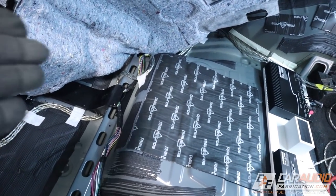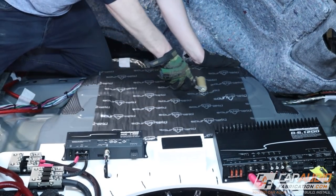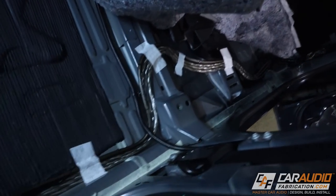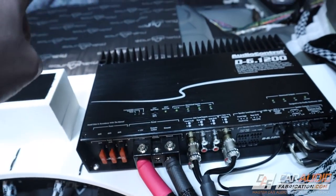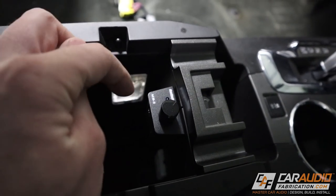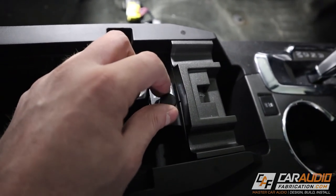Since I have the carpet removed and the seats removed, I figured why not throw down a little bit of sound treatment on the large flat areas that need it the most. So I did that really quick. Now I have completely ran all the speaker wires on the passenger side of the vehicle following the same techniques I used on the driver's side. On the passenger side, I've also ran my RCA wire here that connects to the head unit up in the front of the vehicle, which provides signal to the amplifier. And I've also ran the wire for the ACR3 from Audio Control — this connects to the amplifier so I can switch my presets and control the level, which I'm going to use for subwoofer level.